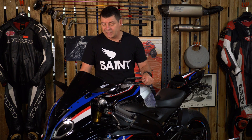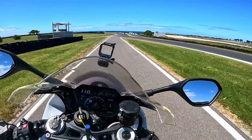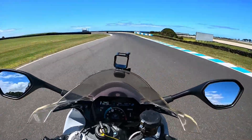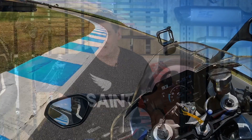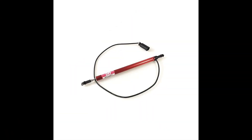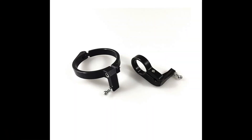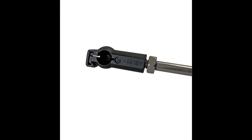I was put onto this because I talked to my good friend Chris Lynch, who does the mechanical work for the Superbike School here in Australia. I was talking about a feeling I've got — the front end feels like it wants to tuck a little bit. He was talking to me about changing the compression and rebound damping at the front end, but unfortunately you couldn't do that. So he put me onto a device made by a company called 2D — it's called a 2D position sensor or a front suspension position sensor — and it basically replicates what's on the back of the bike.